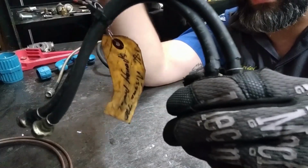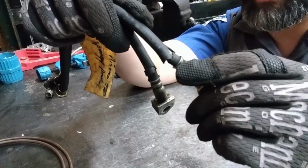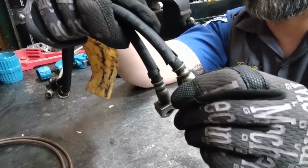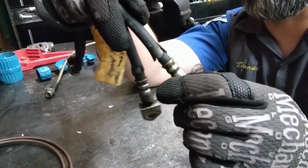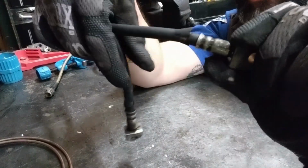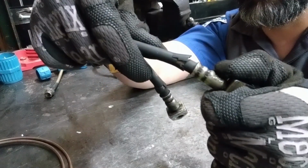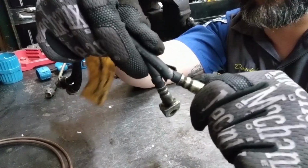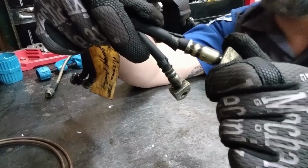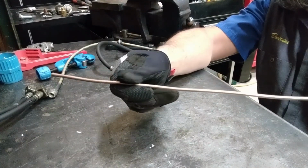The reason why that fixed it was under pressure. That fluid pressure was causing this to bulge, and rather than having hydraulic pressure go to the brakes, the hydraulic pressure went to the hose, allowing the pedal to sink farther than it's supposed to. So the driver felt like the pedal was soft or spongy, almost like having air in the system. So visually inspecting our flexible hoses for wear like this is something that we can spot and resolve before there is a customer concern of having inadequate braking abilities. Or some other reason, if these lines get pinched, is another reason they might need to be replaced.